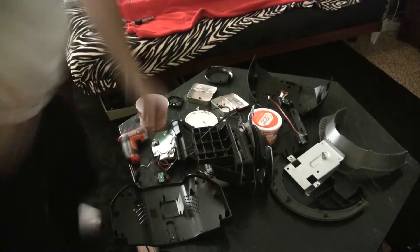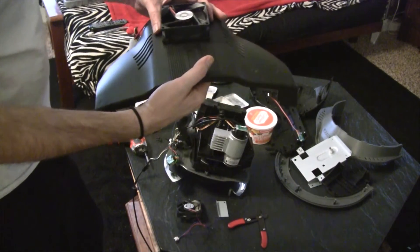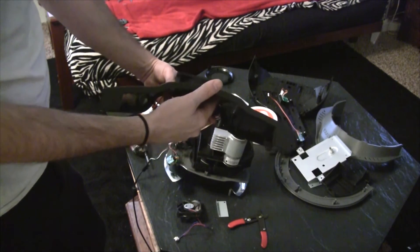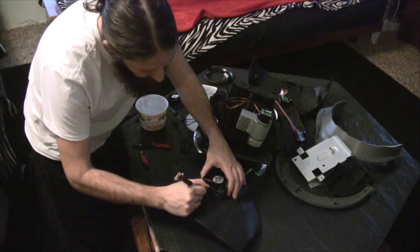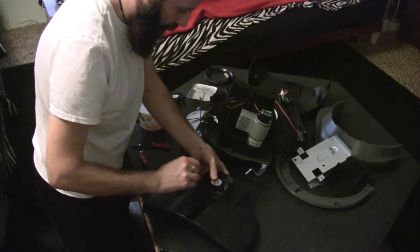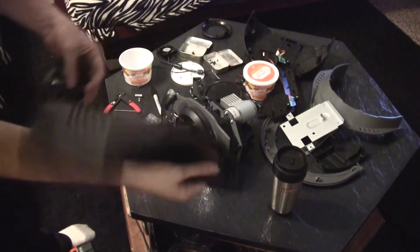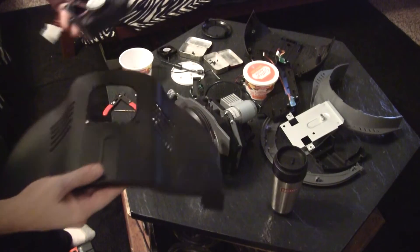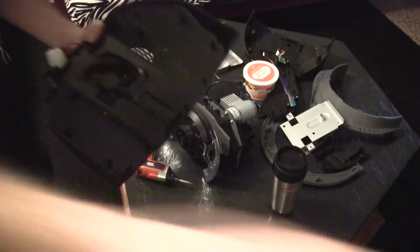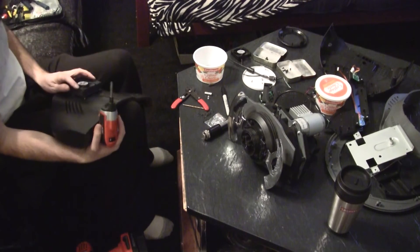We're going to make it run like a fridge pretty much — it's going to be so much colder. I had to go outside to use my soldering iron on this, but as you can see it cut a nice big hole out to fit wide open over an 80 millimeter fan — a standard 80mm — so you can get a nice quiet one, or a PWM controllable one, or whatever you like.